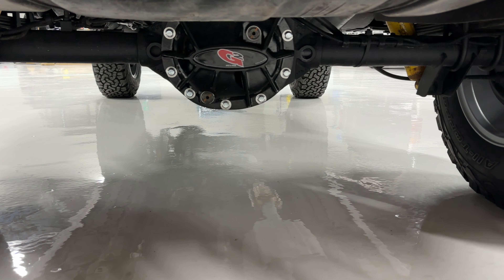All of the black on the Jeep — the front bumper cap, the bottom valence, all three pieces of side trim, the rear bumper caps, and the same on the other side — all were removed completely, sanded down with multiple grits of sandpaper, stripped down, sealed, and then sprayed with our two-part Kevlar. These were reapplied with 3M body bond, so these trim pieces are not going to come off or peel on the corners like factory trim with double-sided tape. Very durable, won't fade.